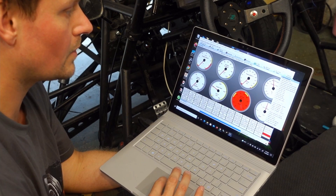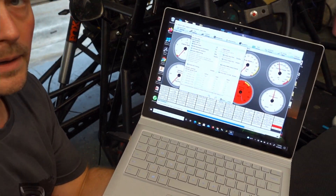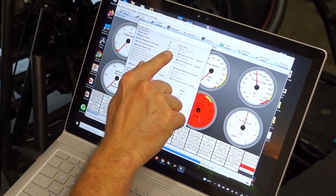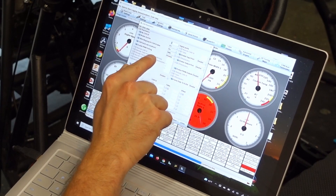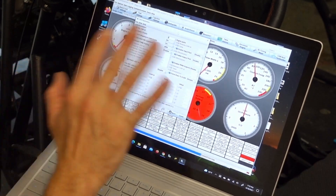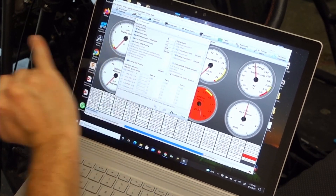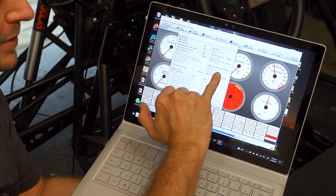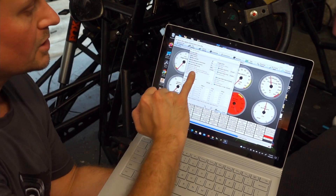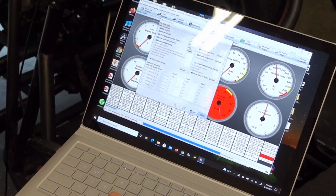Come over to CAN bus and into CAN Parameters. My CAN ID I'm leaving at zero. Master Enable is on. 29-bit Megasquirt CAN Enable is on. Baud rate I have set to 500k. Enable PWM Polling — it came disabled and I'm leaving it disabled. Enable Input Port — disabled. Enable Output Port — disabled. ADC Polling — disabled. The main thing is the Master Enable: turn that to On, burn it to the device, and close that screen.